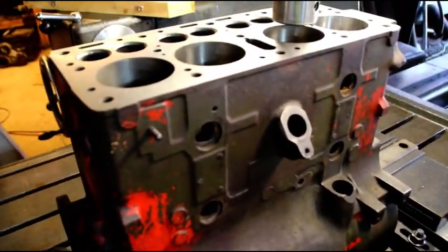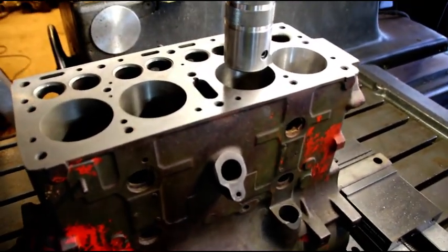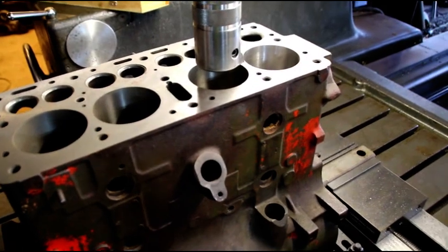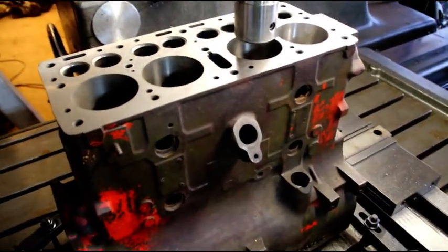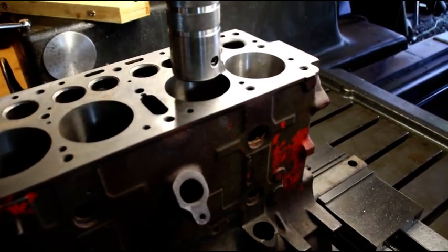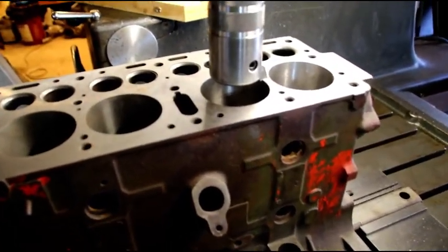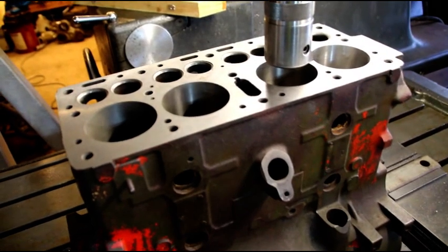Welcome back, working on Travis's block today. If you've been following Travis's rebuild, you know he had sleeves put in by a government rebuild and they were in crooked. When I first tried to bore it, I centered on the top of the sleeve and was almost out of the sleeve by the time I got to the bottom. I have it on the SIP now and got the first hole bored, leaving five thousandths for honing - we're at 3.1250. The first-to-second hole spacing should be 3.437, but when I went to do that I was hitting in the front and away from the back. So not only were the sleeves in crooked, but they were not placed right.